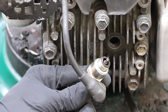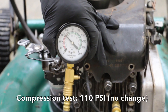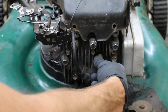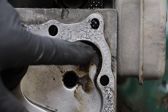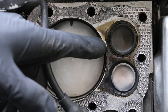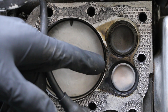Wow, check out all the buildup on that spark plug — definitely a lot more buildup than some of the other alternative fuels that we've tested in the past. There are some very thick carbon deposits built up on this cylinder head, especially around the exhaust valve. A lot of buildup on the intake valve and definitely a lot around the exhaust valve. So charcoal lighter fluid — just one tankful — could cause a lot of carbon buildup.